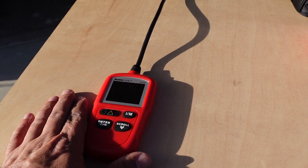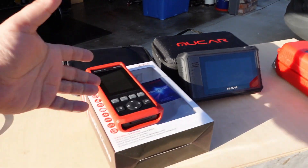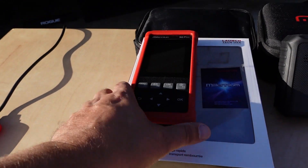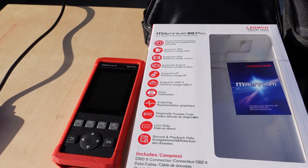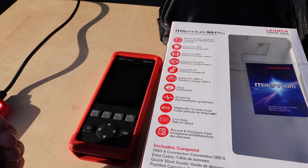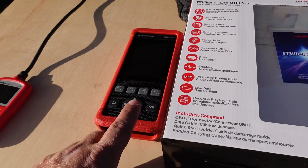There's a generic code, but if you worked at Mercedes-Benz, they have their own scan tools — part of the star system, for example — and they have a better idea of what's happening with that vehicle. So we have advanced scan tools like this. With this scan tool, you can get the OBD2 code just like the basic reader, but it also shows you the original Toyota or Mercedes manufacturer-side code. You can view live data, check SRS problems, ABS problems, and transmission problems.